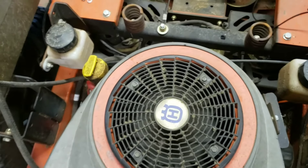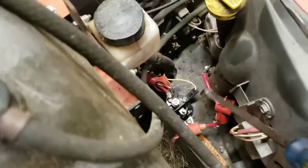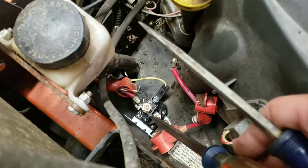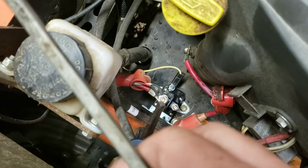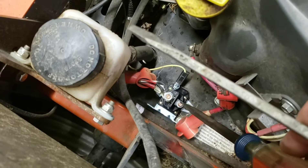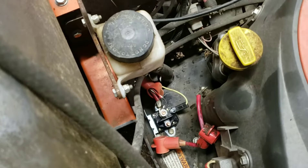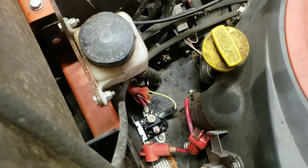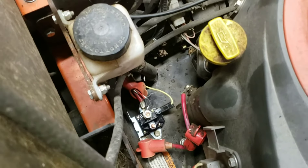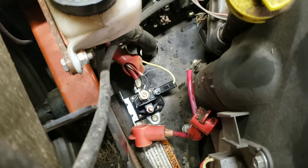The way I got this in the garage from the barn was I bypassed the solenoid with two screwdrivers. I put one screwdriver on each side and when I touched them together it completed that circuit. I would not recommend doing that every time you start one, because it bypasses all the safeties and it's not good for the solenoid or the wiring either. But it will get you out of a pinch — get you into the garage where your tools are. Anyway, just wanted to go over how I diagnosed and repaired this. Hopefully it'll help somebody out. Y'all be good, appreciate it.